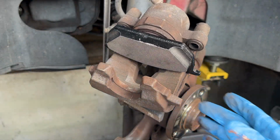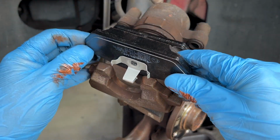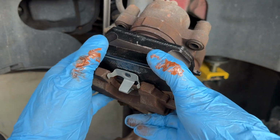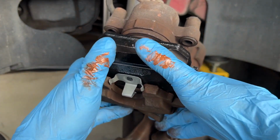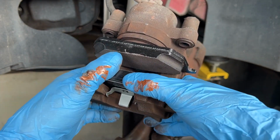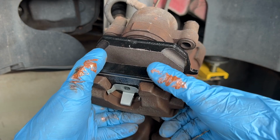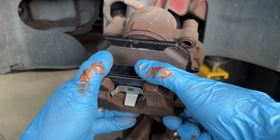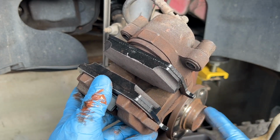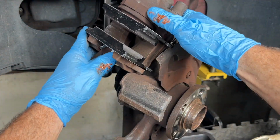And then we've got to do the same here with the other new pad. I think this one just slides down for that spring clip. So you just sit him there, look, and press him down in. Yeah, there he goes. That's it. Oh, there, just felt him clip in nice then. So that's your two pads preloaded in the caliper, ready to go on. We'll put the brake disc on, or you may have your old brake disc on, but they're ready to rock and roll.